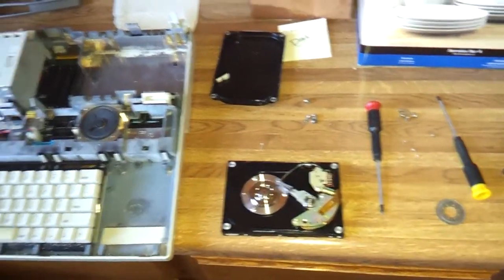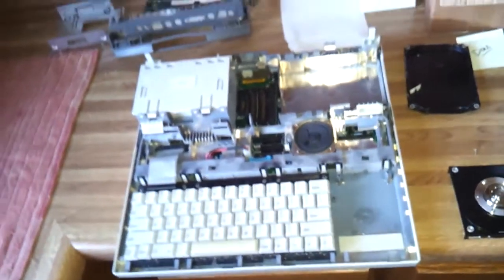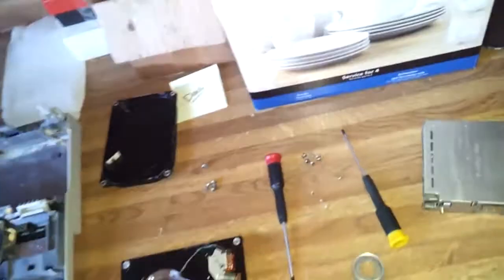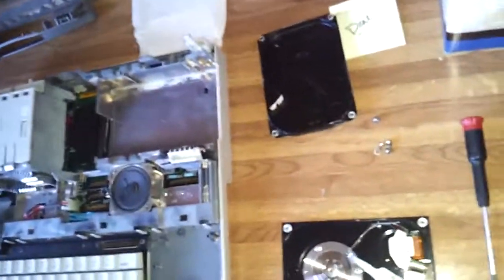You are going to see the rest of this video because I want to be able to prove a point here. I let it sit overnight cured, put the portable back together, and it didn't work — it gave me the click of death. So I was going to destroy the video, but I took the platter out to find out why. And it was nothing that I did, because the gasket material stayed in the rim — it didn't seep out, everything was good, sealed up perfectly, which I knew it was going to. But here's our problem. Ignore that — that's my thumbprints. You can see some of that goo. That is not the silicone; that was what was left of the gasket. It actually got on the platter and the head dragged it around and destroyed it. So this drive was gone before I even started.